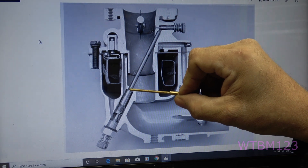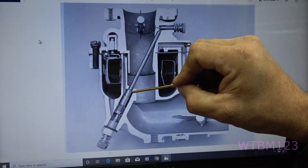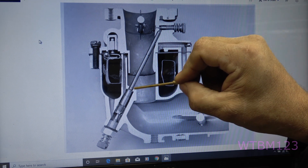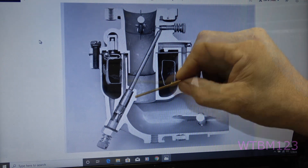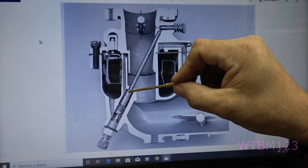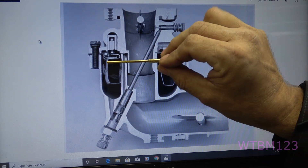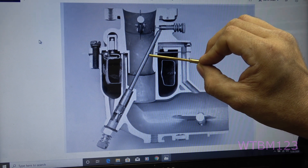Usually what happens is right here on this taper — which is this part of the emulsion tube — it has to conform to the soft metal here. When you tighten this up and down a few times, a lot of times you'll hear it squeak. It's soft metal but you've got to get it pretty snug or it will leak. The fuel comes up through here and out that hole, can fill this area up, and if this isn't seating right it'll run right out and down into the carburetor, because your fuel level is up here.